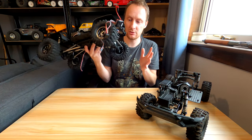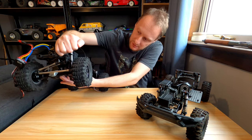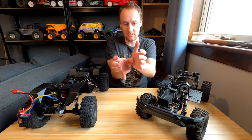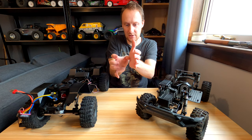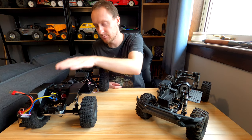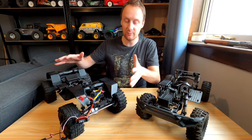I'm not sure what size of shims I used because they were just lying loose. Basically you've got the bevel gear and the pinion gear in the axle housing — it's a solid axle, not a diff. They're too close together, so if you put a shim on the side of the bearing it pushes the gear ever so slightly, giving just a little bit more play, and it seemed to quiet down. I had to do two shims at the back of this one and one at the front. Both these axles are better than those two were, so I imagine just one thin shim on each will do it.